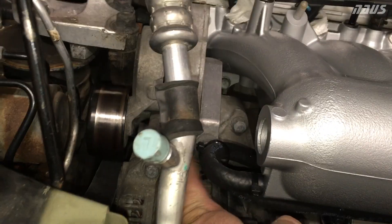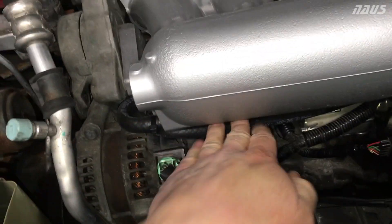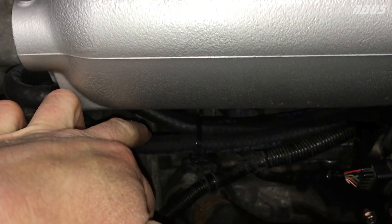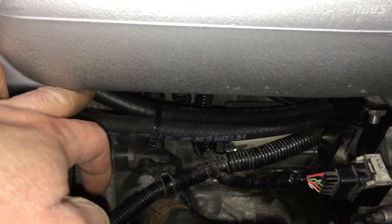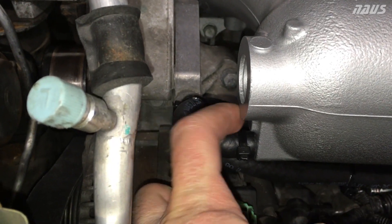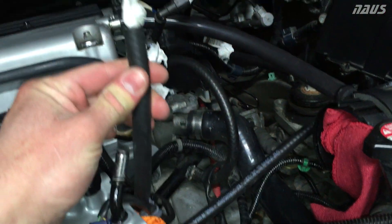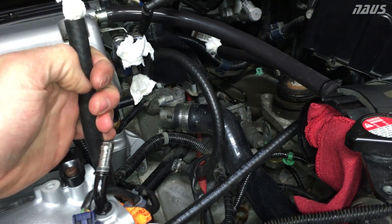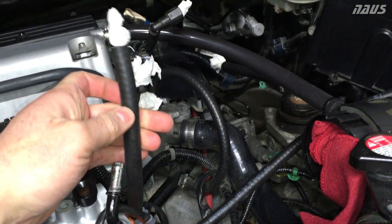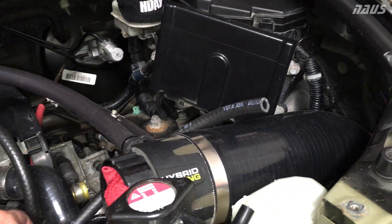The PCV valve is over here, of course on the bottom. I have two hoses running, kind of zip-tied nicely together as you can see there. So the one out of the PCV runs underneath, and then this is a stock RBC manifold, so we just loop that one around back — they run underneath the car together. This is the side of the manifold, so the flow goes down through the tube to the RBC manifold, and then the hose over here is straight from the PCV.